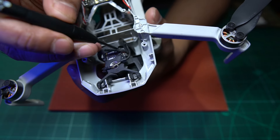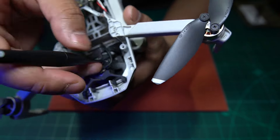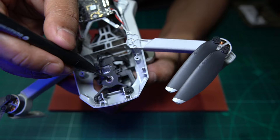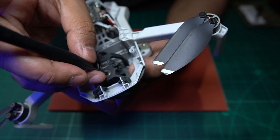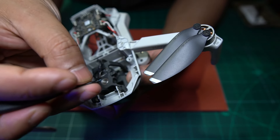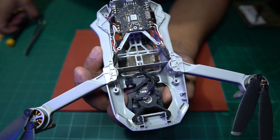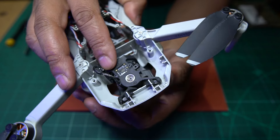To release the camera, I'm going to open these two screws here and this one screw here, and also there's a screw inside here behind this cable that should allow me to free the camera. We're going to open this screw here - and that's allowed us to free the cable straight away from here. We've got one more screw inside here - just got to hold the gimbal from the camera from the bottom while you do this. There we go - the second screw is out from there. When you put these screws down, do put them in an organized way, otherwise when you've got to put everything back in you might get confused.